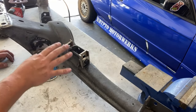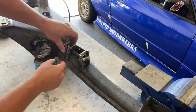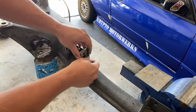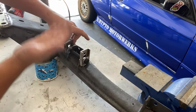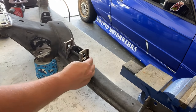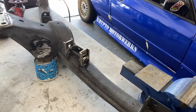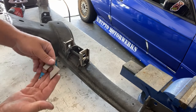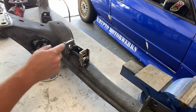The way you want to do this is you obviously don't want to add any positive camber, which is going to be down towards the subframe. So you want these tabs pulled up as high as you can, so all the adjustment is for negative camber. Pull these all the way up, making sure they are in fact all the way up, and you also have these little brackets here that will just be for some support on the top side.